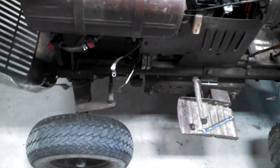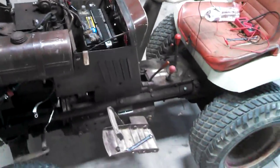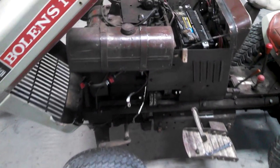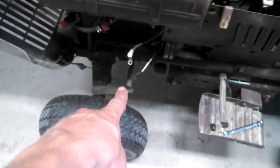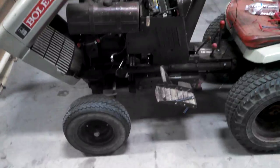But just fresh off the charger, I hooked it up and wanted to crank it over, it did nothing. But alright, maybe it's a solenoid, because it didn't seem like the solenoid was clicking right, so put this one on. Still won't crank over. Hook power directly from battery to starter generator and nothing. So it's up at Mike's Electrical getting looked at.